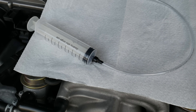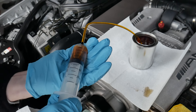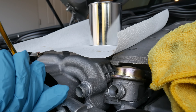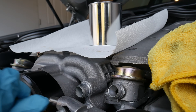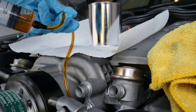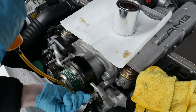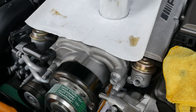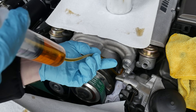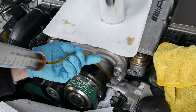To fill my supercharger I will put in 50 milliliters of Mobil Jet 2 three times with a syringe and a new piece of hose, totaling 150 milliliters. If you fill more than this — such as filling it to the level of the access hole — you could risk the oil seeping through the breather hole of the pulley bolt. The key to this job is getting everything out and putting the right amount in. Some posters on MB World report only extracting 30 milliliters and filling something like 120 before the oil starts rushing out of the hole — this means they didn't extract enough oil. If you get the hose at the right angle you will get the oil out.